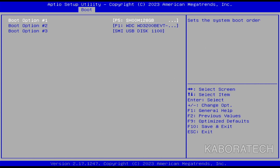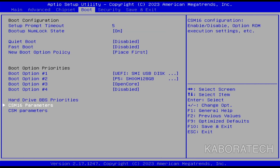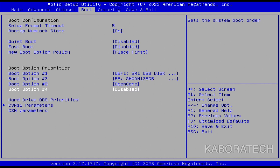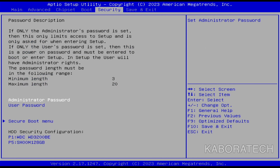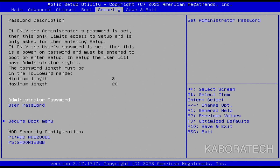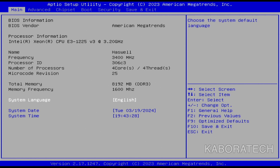The 128 GB drive is Windows 11, the other is a data disk, and the third one — the UEFI USB disk — is a flash drive with Ventoy. After setting this, I will save and exit. You can see the processor and everything listed there.